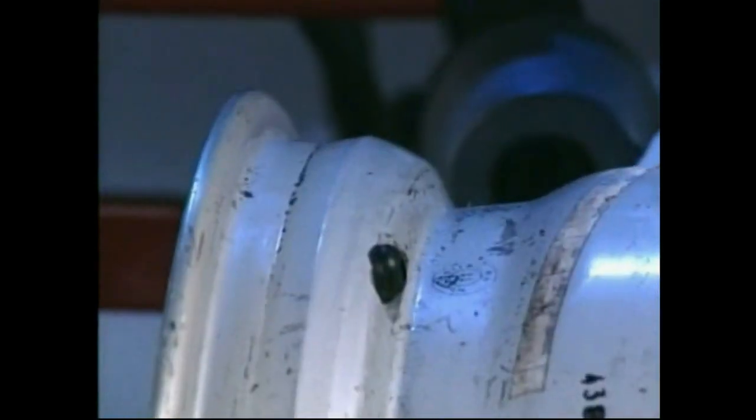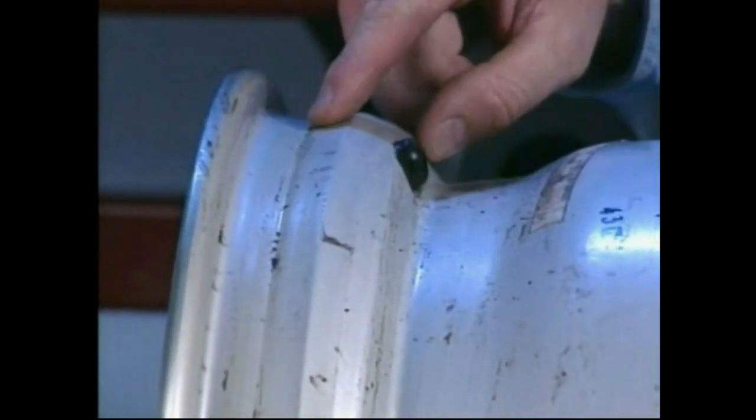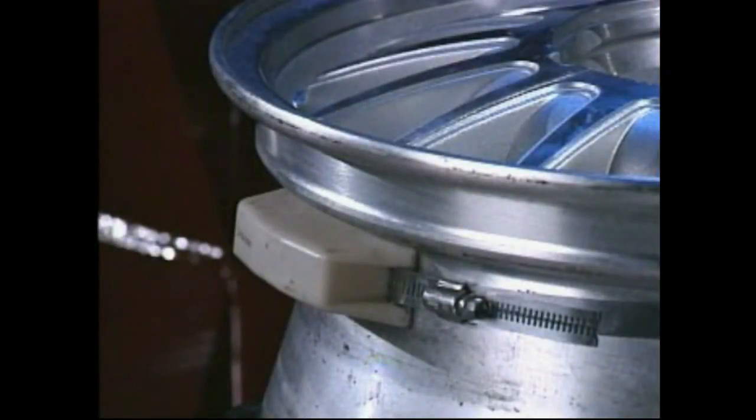Wheels with an asymmetrical hump have a larger ledge-type hump around the wheel, except at the valve hole, making them more difficult to mount and demount. Some wheels have a low-pressure sensor transmitter strapped to the wheel. Others have a sensor mounted directly to the valve stem. This is especially true on run-flat tire wheel systems.